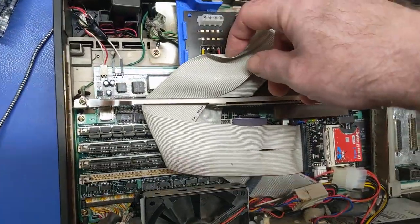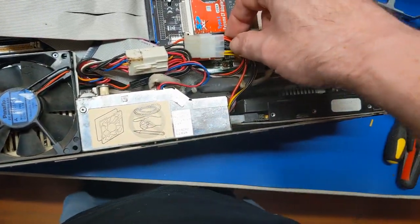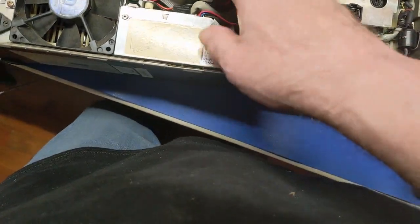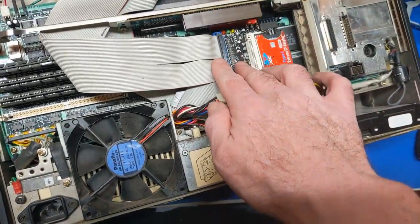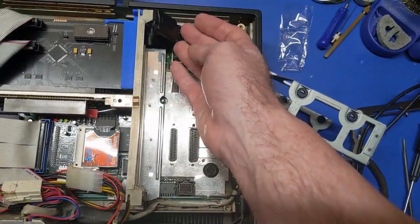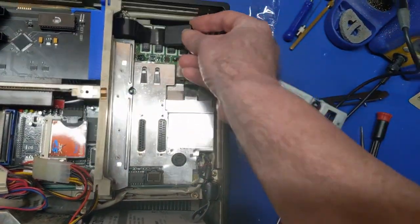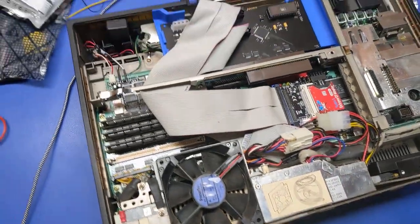I got the power cable soldered in place and then snaked down there. And it's plugged into this Y cable right here, which is going to the Berg connector as well as this drive. So yeah, this should do it. And then I have the compact flash adapter just kind of stuck in here right now, and I have the cable snaked out this way up underneath the micro channel card. What I'm going to do is put this on Velcro, I think, so I can always take it off when I need to remove the back cover. And then it'll just naturally sit right here on the back cover so I can put an SD card in there. And that should do it.